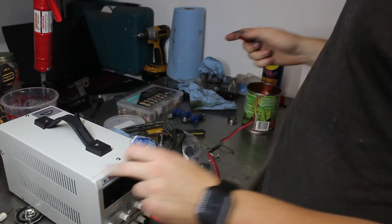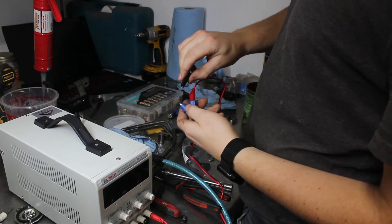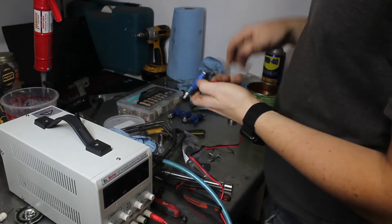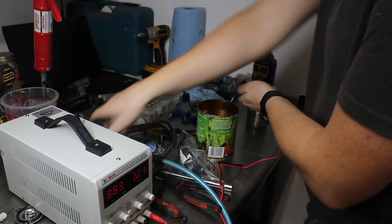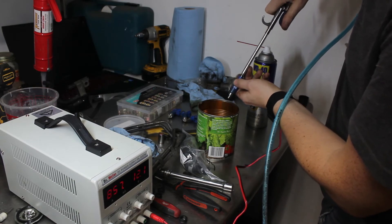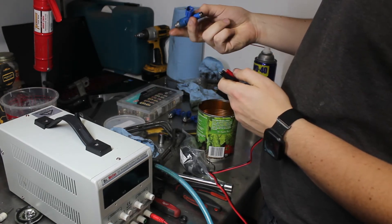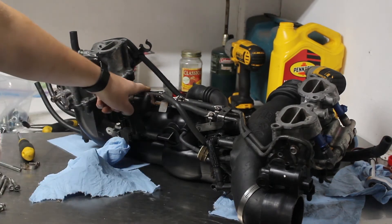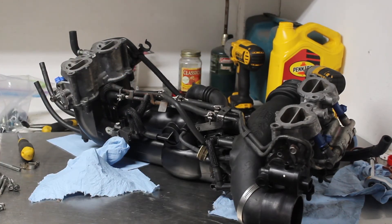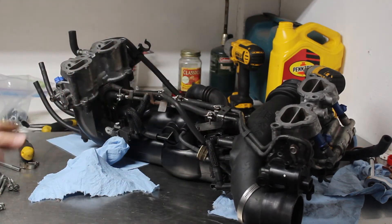I'm cleaning up my injectors. I've got my power supply set to 12 volts — it's pretty simple. I use alligator clips to plug them in. Polarity does not matter. Turn it on, it opens the injector up, then spray some carb cleaner in and blast it out. A nice healthy spray comes out the other side, so that should make sure they're pretty clean. I got the intake manifold cleaned up and replaced a couple fuel hoses that were damaged from taking them off the first time. Got my intake manifold gaskets in — they're kind of tight and look taller than the old ones, but it's a good seal. I'm going to drop it on the engine now.